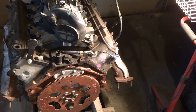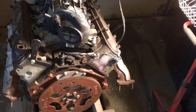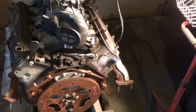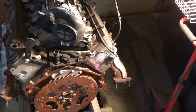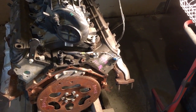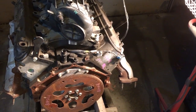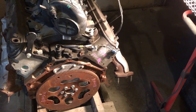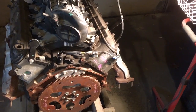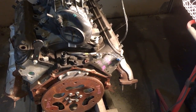That's why I wanted to clarify the difference between an iron block and aluminum block. When you go look at an iron block engine externally, you're not going to be able to tell whether it's a 4.8 or 5.3 — you have to see those pistons to verify for sure what you're buying. In 2006 and newer, 5.3s came with flat top pistons and full floating pins with an aluminum block.